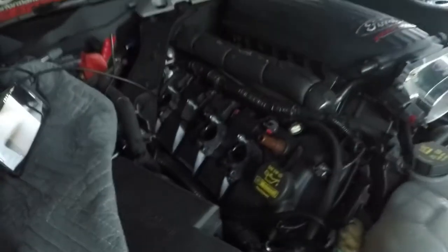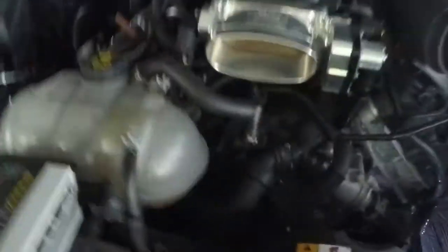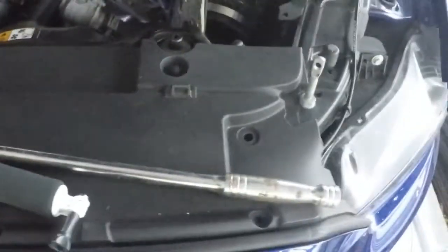We'd better watch the screen than try to watch the camera itself. I'm going to go just past the spark plug threads, and then I'm going to turn the crankshaft. You can see I've got a ratchet down there. Once I get it in the right position, I'm going to put the big breaker bar on it to hold it still, because if it moves, the valve will open and you won't get a good reading at all. This can be done with a simple little air compressor — the bigger the better, because it won't cycle on and off.